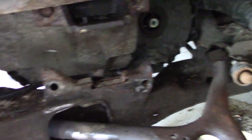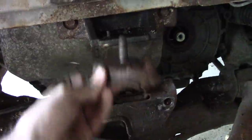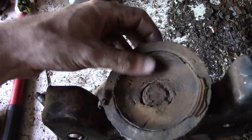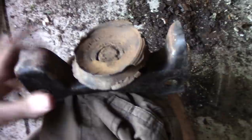Every single Ford I've run will break this motor mount. The bracket sits right in here, there's a piece of rubber in this cup, and all I do is take that nut off, put a jack under the engine, jack it up, and pull the whole thing out. What happens over time is the vibrations and stress from shifting just wear this ring out — the rubber is supposed to be connected to it but it rips apart. You can replace it and put a brand new rubber mount right there. I'm going to go junkyard hunting or online to find a new one at a cheap price.